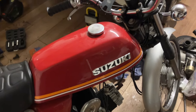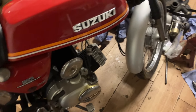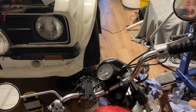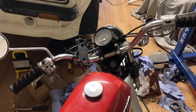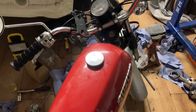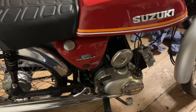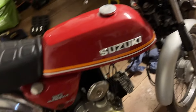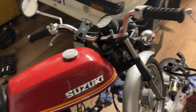Just need to get some Dr. Martens now. All right, I think that's it for this video. I'll have to look into the gearing - it seems to get to 40 but the revs keep rising and it doesn't go past that. Maybe I need to take it for a longer ride, or leave it for six months then thrash it. At least the fuel seems to be going through into the carb now, which is good - that was probably a blockage from not using it often. I do think it needs a bit more fuel in there as well. Thanks for watching.